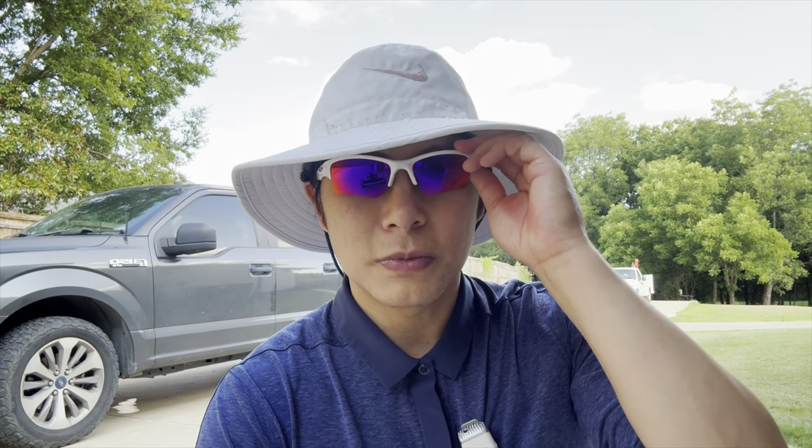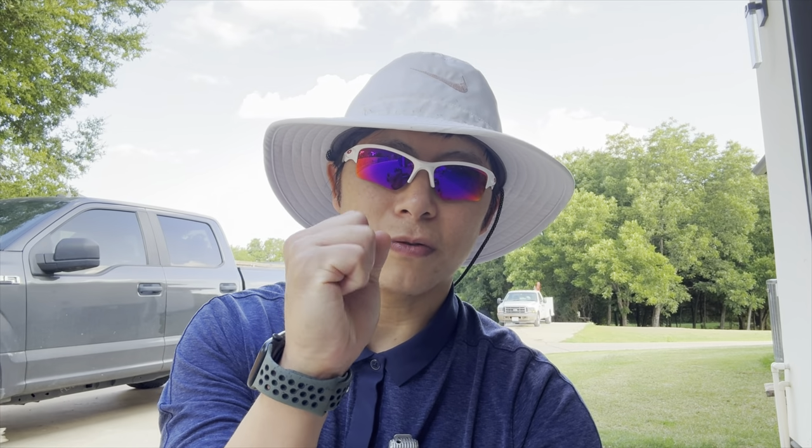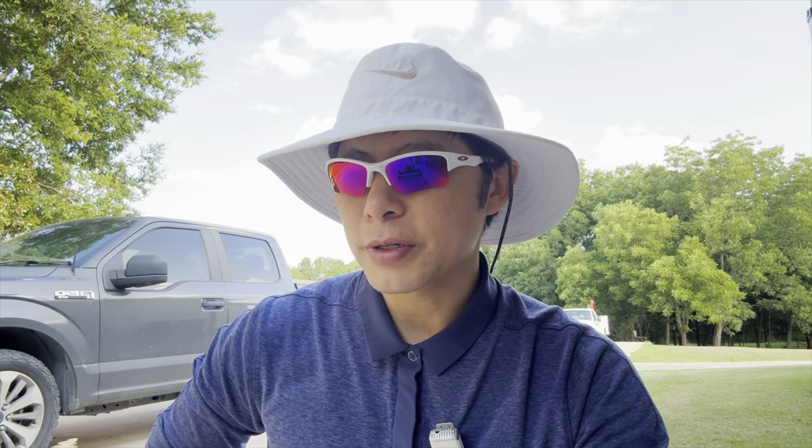He taught me a lot of things. I learned a lot about the sharpening, relief grind, and those things today. And I may make a separate video for that to talk about. He did explain to me reels that have a spin grind on them, or the flat edge versus a relief grind. He explained the differences and the reason why one would be better than the other.